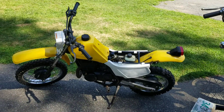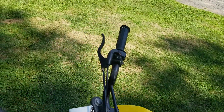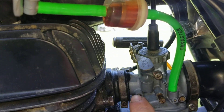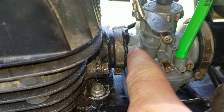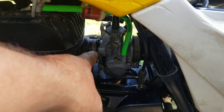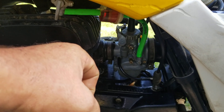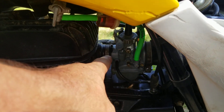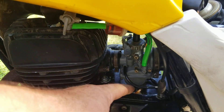Now when I got this bike, the carburetor was hanging off of it. See how the carburetor sits into the boot right here? This little notch on top where the carburetor sits — that was actually moved back. The clamp was tight but it wasn't around the carburetor, so it was hanging on the very edge. This became an air leak, and when that became an air leak, it sent the bike into a lean condition.